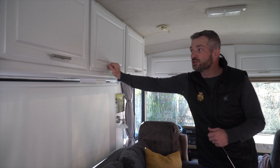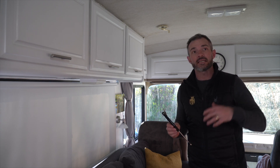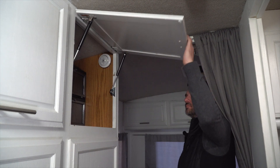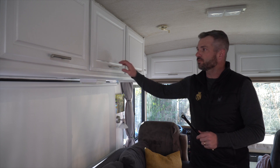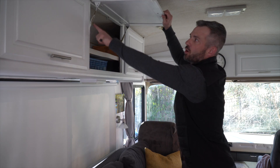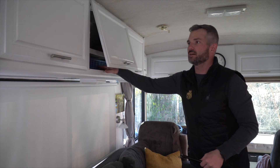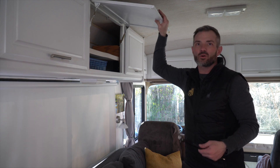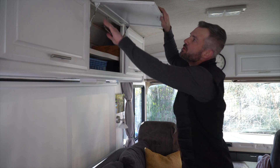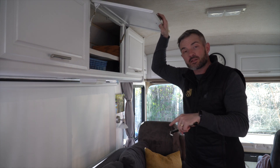One of the newest things I wanted to show you is installing new struts. I've already done this on a couple of other cabinets in the bus. What we're going to be doing is installing these new struts because over time these cabinet doors — which lift up — they've got these older struts that are just basically giving way. They're not holding the cabinets up anymore, so you're at risk of it closing on your hand or your head, which has happened to me more than once. It's just not convenient or frankly safe. So I'm going to be removing these old cabinet struts and installing new ones from Amazon — I'll have the link down in the description.